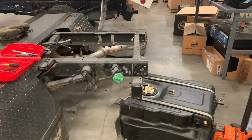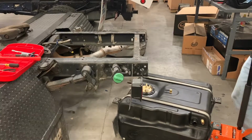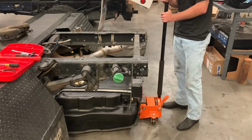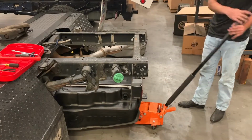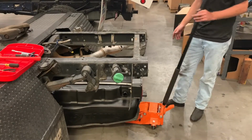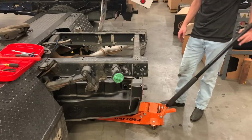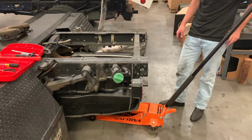So now go ahead and position your tank back onto whatever jack you're using. Roll it back underneath the truck. And here, just make sure you're clear of all the brake lines and other stuff that's around that rear axle. Start jacking it up, and for those of you who don't have as nice of access to your tank, which is probably most of you, remember when you're about 8 to 10 inches shy, go ahead and crawl underneath and get your lines all back hooked up.